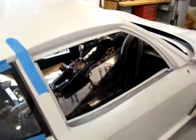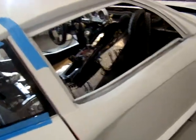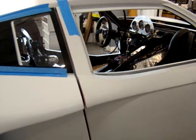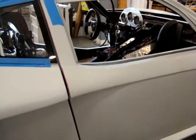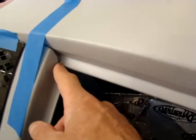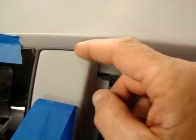So anyway, some of the things you want to look for, especially on the doors, since I'm standing here. Everybody knows the doors are a challenge, and so what I did is I went through all the headache of cutting the frames, making the door fit, trial fitting the glass, trial fitting the seals, making sure that I have the correct gaps in here where the seal goes. There's a gap right here that needs to remain clear.